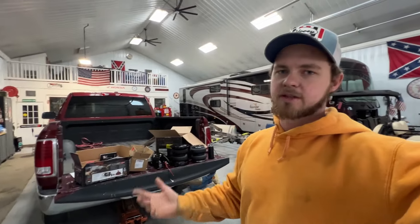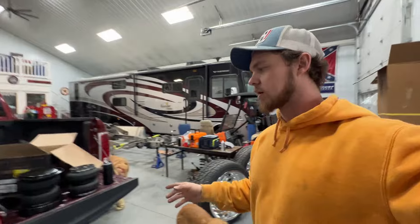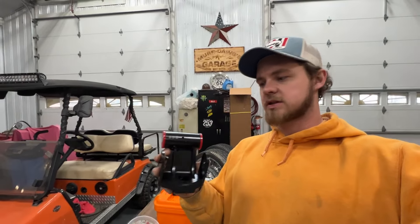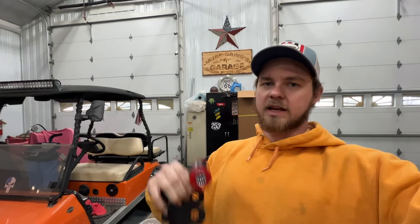I've done a bunch of shackles on the Dakotas because they all rust out and you've got to replace them — those are a pain. However, I'm really hoping these come apart way easier. Here is the drop shackle. As you can see, the wide part is where the leaf springs attach, and then the red bushing part is where it connects to the actual truck.